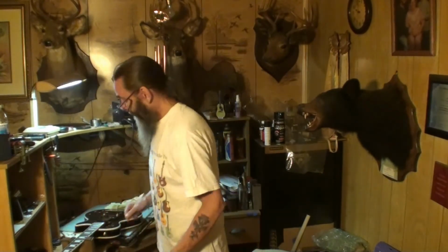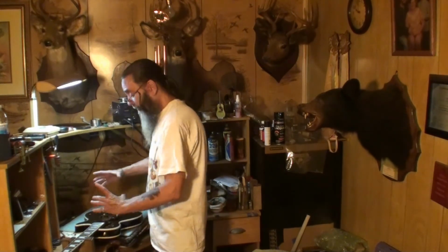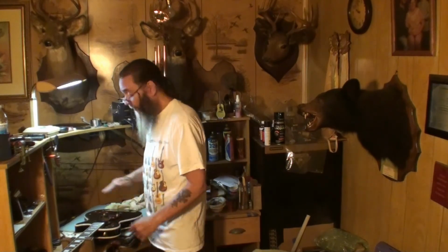And like I say, the harder you apply it, press on it, the deeper it's going to dig in. So you might have to start off pretty hard, depending on how deep the scratches are. I would start easy and see if you can rub them out easier or not, and then rub harder until you get them out. And then put a couple coats on, rubbing lighter each time, and you work your area bigger as you near your end.